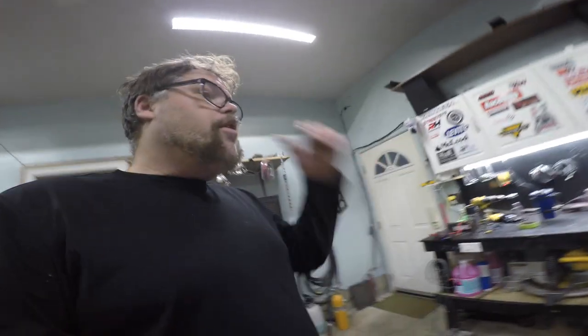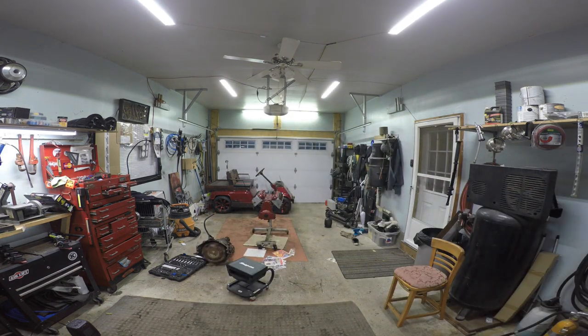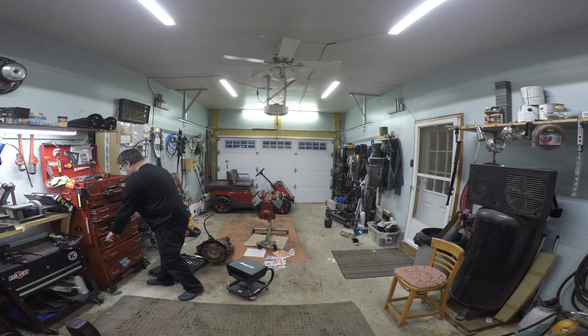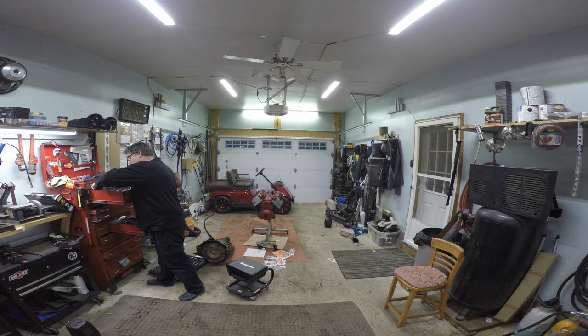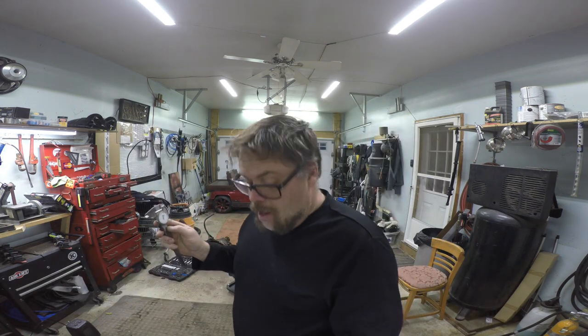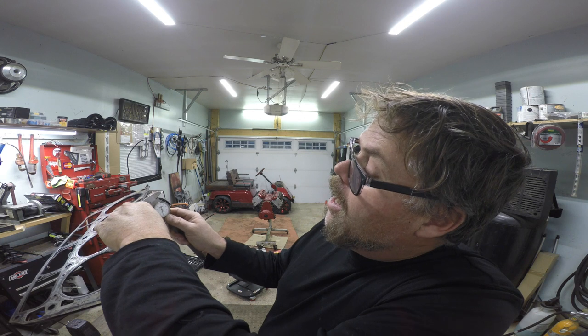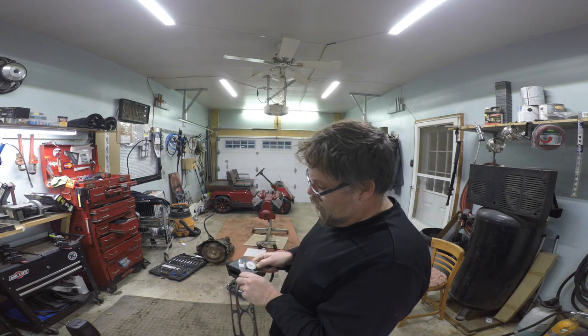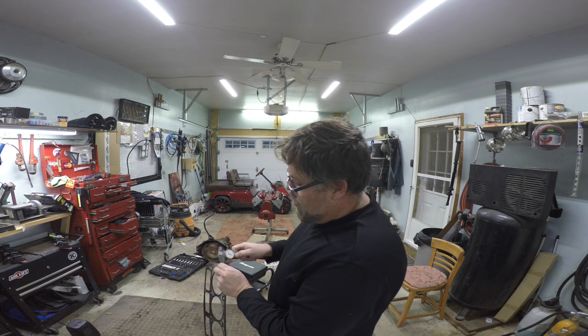What I wanted to do is measure my old head gasket and see what thickness it was — so you know what thickness to get. Here's my head gasket and I'm going to get out my trusty calipers that I don't really know how to use. We'll zero this bad boy out — zero. So now we'll take the head gasket and give it a measure. These ones, it's saying 55 thou. Wow, that's a thick gasket. I don't think they make a 55 thou. Maybe 50 if you really push on it, so say it's around 50.